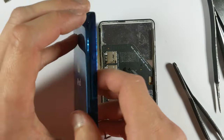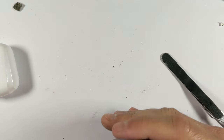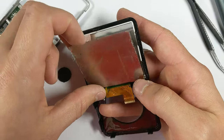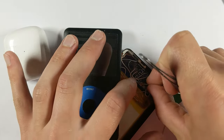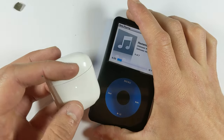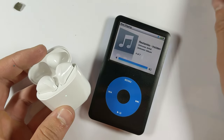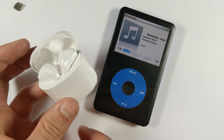You can also technically install this into an iPod Classic 6th or 7th gen, since they use the same rear housings, headphone jacks, and batteries. I did try that as well, although there's one issue: Bluetooth can't easily pass through aluminium, which the 6th and 7th gens are made from. I removed a small reinforcement shield from behind the LCD in hopes that the signal could pass through the screen. The Bluetooth board has a connection point for an extra antenna, which happens to be the right size for one I pulled from a broken Nintendo DS, so I plugged that in as well. It does work, kind of, but the range is pretty limited and the audio cuts out only after a meter or two, so it'll work if you're just using earphones in your pocket, but I still wouldn't really recommend it. It works much better with the 5th gen.